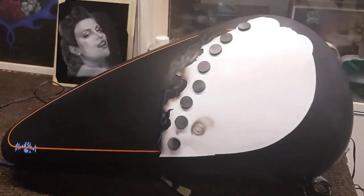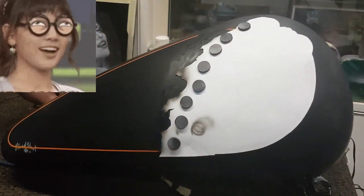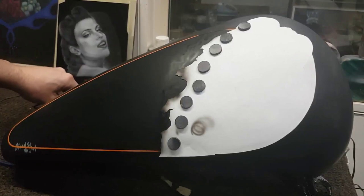This is the urethane paint to match the black base, thinned out quite a bit, and as you can see as we speed this up, I am just going to the outside of these lightning bolts, just softening up, keeping that interior glow, knocking back some of them bolts to make them look three-dimensional, and just giving the whole thing a little bit of a dark tone. And now you can see with the lights off, we've pretty much got them hidden.